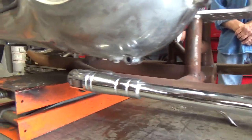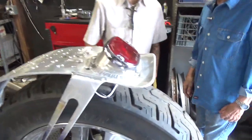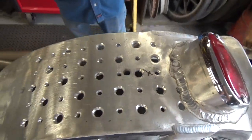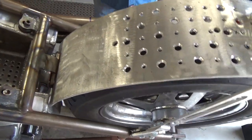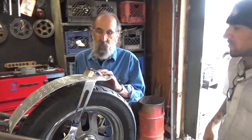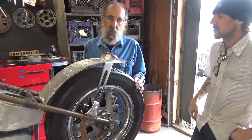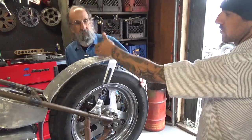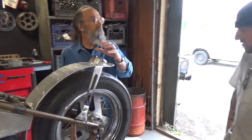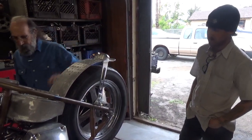There's actually a lot of chrome that needs to go on, but it's getting pretty dang close. And we kind of skipped over the taillight — I think it's very cool. Those are my favorite taillights — I always call them sportster taillights, but they came on pans starting in '55 and they used them right up into the early seventies. RH 55. This is an original piece — that's a real Guide lens. Guide was the subcontractor that made them for Harley-Davidson, and Guide was a division — may still be a division — of Pontiac.